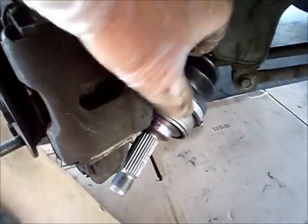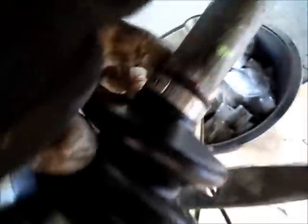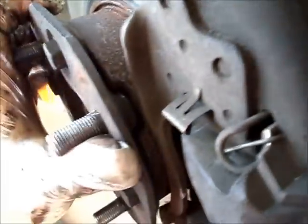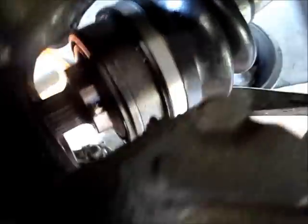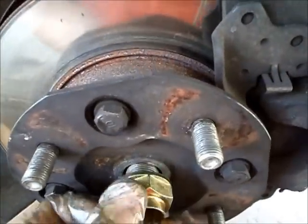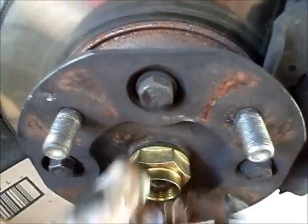And now for the second half, we're going to do the other end. You can kind of pull this out of the way. I was able to basically just wiggle the axle around and rotate it back and forth — you could also just move the disc until those splines find their spot. Then it's just a matter of a little wiggling and a little English, and it will eventually push its way through. Now that it seems to be through all the way, I am going to put this new spindle nut on.